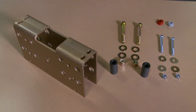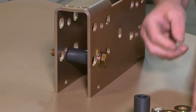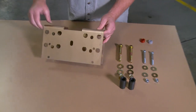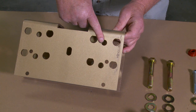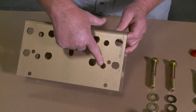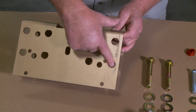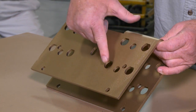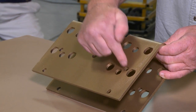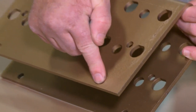This is the kit for the Liberty Rider. One kit fits all size axles. The kit shows the high performance rolling bearings that allow the springs to work without friction. This shows the mounting holes for the 3-inch hangers and where the bushings will mount, and where the 5-inch hanger and mounting of roller bearings will go. These are the mounting holes for the shock bolts, with four different holes for the shocks to be mounted depending on your spring and frame. These holes are for spring retainers, which will not allow the springs to come out of the trailer if taken off the ground.